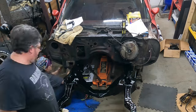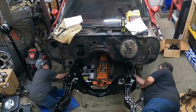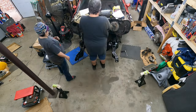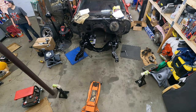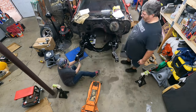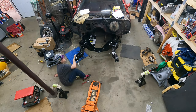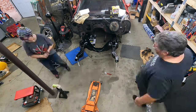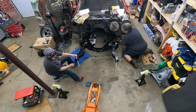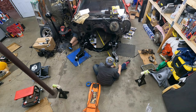The car was in pretty good shape so we didn't really have any issues. Basically we used the alignment holes in the frame and in the body, snugged everything up the best we could, and then got into actually measuring the frame. We did a little bit of front-to-back measuring using the leaf spring mounts as the rear measurement point, then we did some cross measuring from front to the opposite side leaf spring to make sure everything was square. We added some measurement points to the very front of the frame — the alignment holes from the subframe into the body really did seem to put it in the right place, but we double-checked, triple-checked, and quadruple-checked it. Then we tightened the body bolts down so everything was nice and tight.